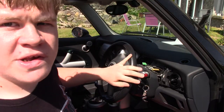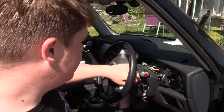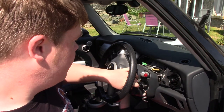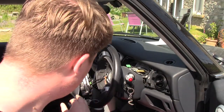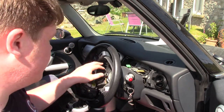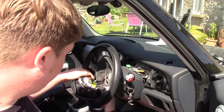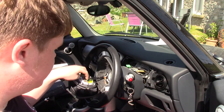The first job: there are two little black screws in the back of the steering wheel on the bottom. I've twisted the steering wheel so I can access them a little bit easier. Don't confuse them with the screws on the silver part of the steering wheel, because that's to remove the airbag — which we don't want to do. All you need to do is remove those two little black screws in the back and then the front airbag part should just pop straight off.